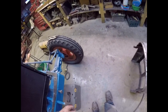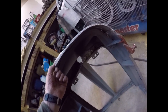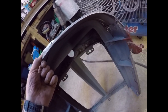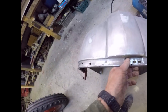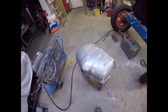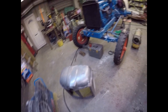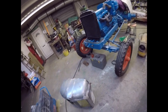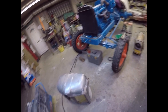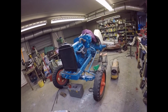So it's coming on apace. Monday: red lead that inside where it's been welded, then spray red lead in there, and then we're ready for grey primer. Hopefully my thinners for the grey primer comes over the weekend. I think I've got enough accelerator - I'll probably get two guns full out of that, and I probably need two guns full. They'll be enough anyway.